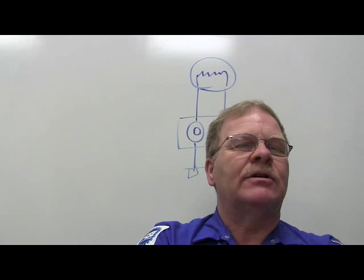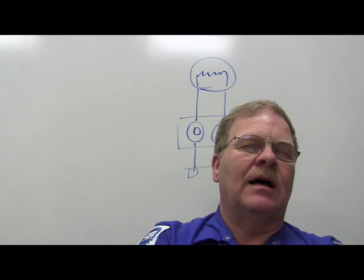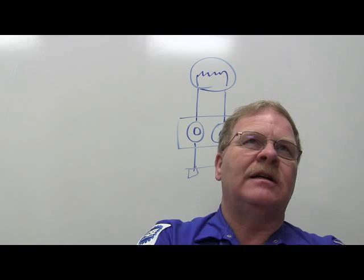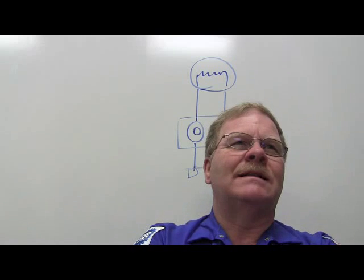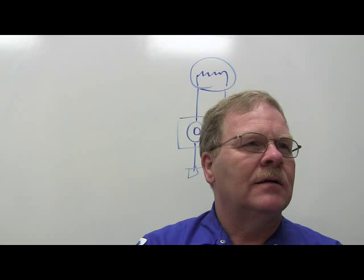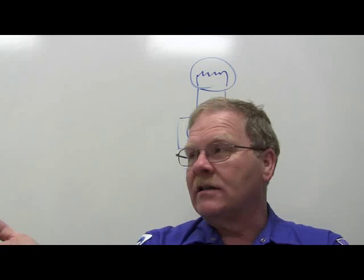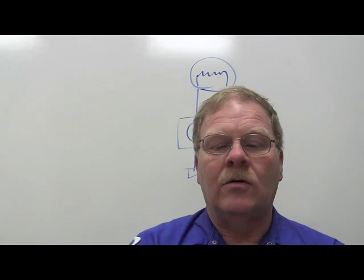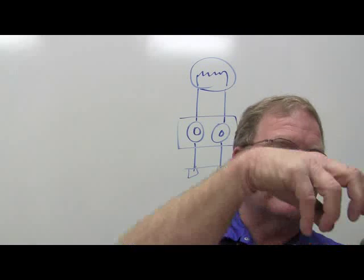Yeah. Well, basically, there's a bunch of reasons for that. But what I always think about, if you drive around on empty all the time, and this is something that he may not even be thinking about, what happens inside that tank on the walls of that tank? We have condensation, don't we? Yeah, and then it runs down in there, and you've got water. It isn't just rust, because you've got a plastic gas tank, it isn't going to rust. But yeah, you don't want that water coming through there. But nowadays, you're drawing the fuel right off the bottom of the tank through some little nibs.